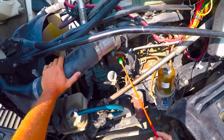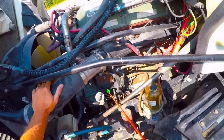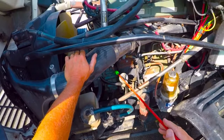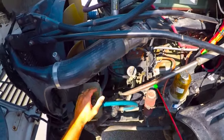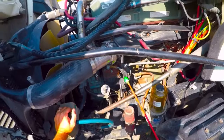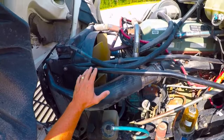This is my air compressor — this is what builds up my air pressure for the truck. I want to check it to make sure it's properly attached and secure. It is gear driven through the accessory drive on the front of my engine. I want to make sure there are no oil leaks, the casing is not cracked or broken, and my hoses are not rubbing and chafing. This hose here is soft and pliable, so that all looks to be good. This one does not have the governor attached to it — the governor is remotely located somewhere back underneath the cab closer to the air tanks.